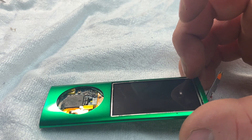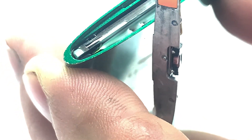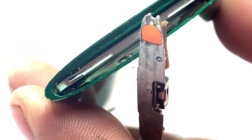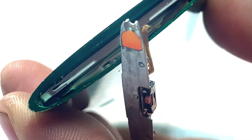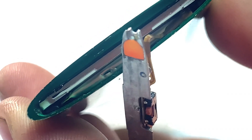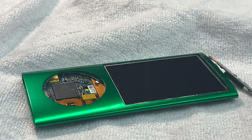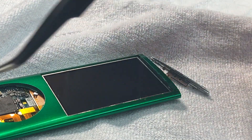This is our battery here, and I'm just going to put a bit of a slit in it so we can relieve some of the pressure. When I did that I heard some gas escape. This battery is completely discharged, so there's no chance it can explode — there's no energy stored in it. Now that we've got that pressure relieved, you can actually see the screen is now perfectly flat. So now we're going to attempt to slide the screen, battery, motherboard, and the hold switch ribbon out of the iPod.